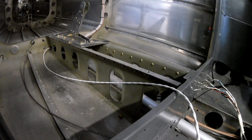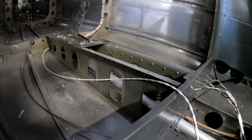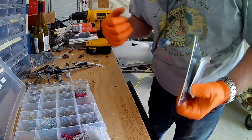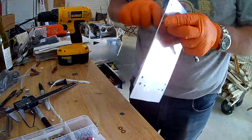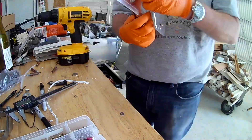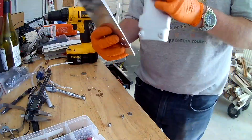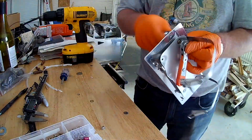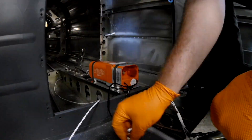You can see the elevator pivot point where the push rod connects from the bottom, and there's another big one that goes to the back and attaches to the elevator horn. Just in front of that is where I'm mounting the ELT. The RV-10 has the same two big center ribs that run down the tail cone, and they already had two spare holes with nut plates. I attached to those, put the plate down, match-drilled a couple of holes into the rib flanges, and mounted it with screws and nylock bolts. There are four holes in the center attaching to the mounting plate, plus two brackets that hold the ELT down.